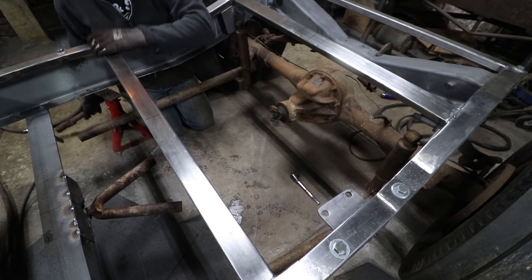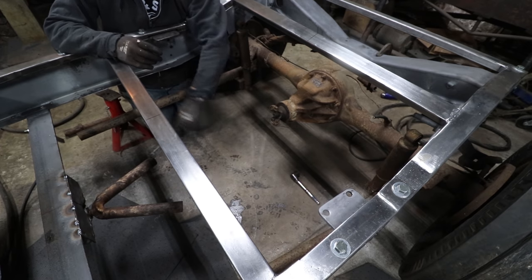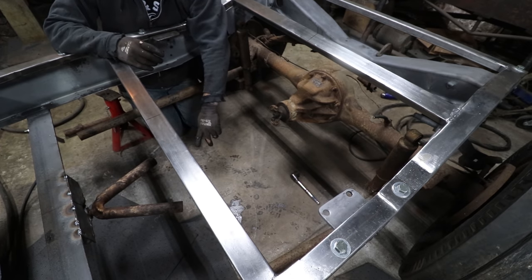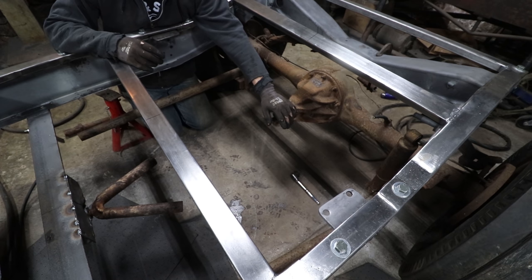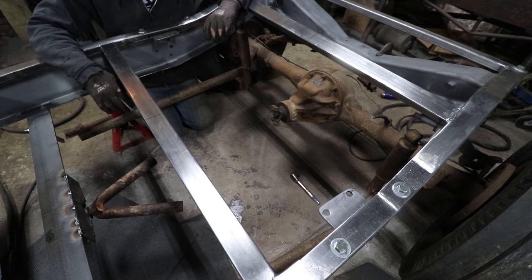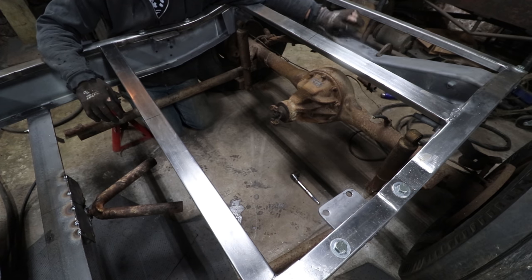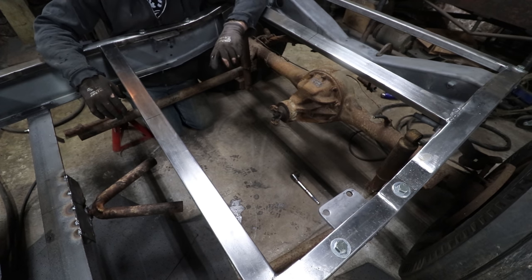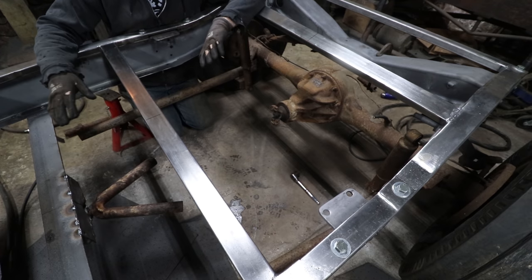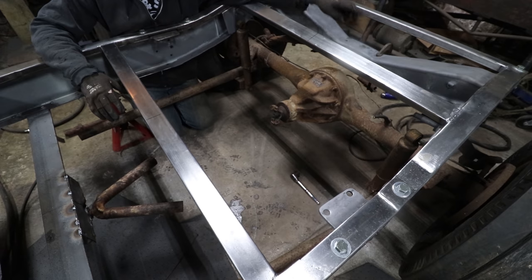So as soon as I cut that, I put some jack stands underneath the radius rods, because I had a feeling that this thing had some pressure on it. I think when they put it together, they forced it into place and just welded stuff, because on the rear cross member, where the square bolt goes through, the back of the hole was tweaked a little bit. The way everything was mounted, the spring was pushed back real hard and it was messing that up.